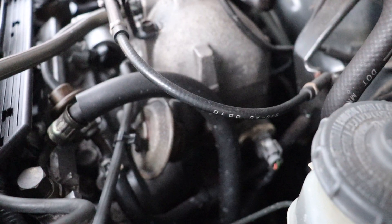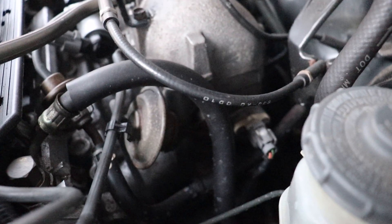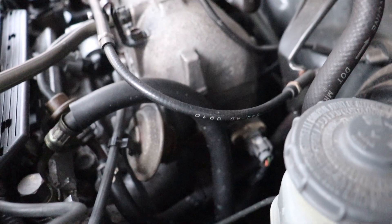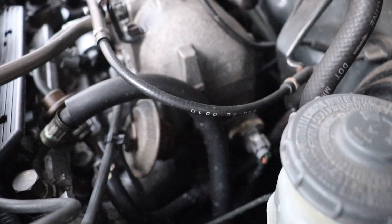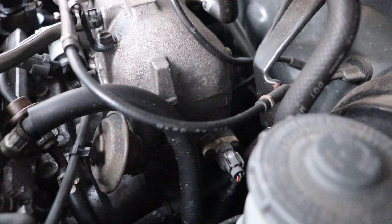The plastic piece inside had broken off with the hole, so I had to remove it, glue it back on, and that got the car running normally again. But then I had a knock sensor code. I couldn't make a video on it because I didn't have the right tools, so I took it to a shop. I got a $20 knock sensor — I'll link it in the description — instead of the $200 OEM one, and it fixed the issue.